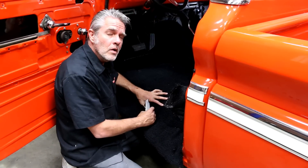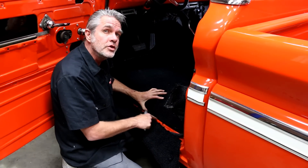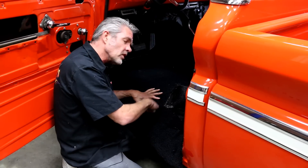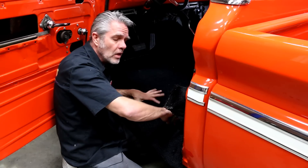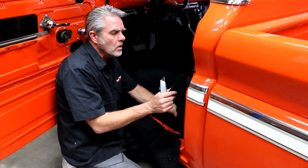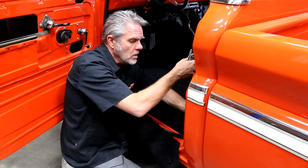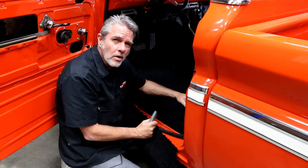From here I'm going to be cutting my carpet — got to be real careful. I'm going to use this gutter right here that's just above our sill plate area, and then I can tuck the carpet into that and use the razor to cut it and get a nice straight line. When I get to the edge here, I'm going to leave the rest of this carpet and just tuck it into the corner so I get as much noise suppression out of every bit of fabric I can.